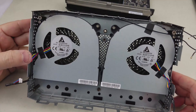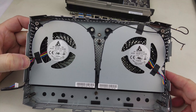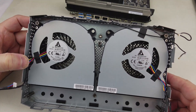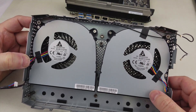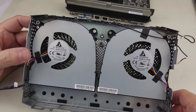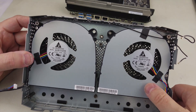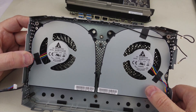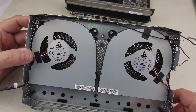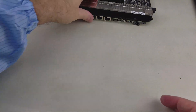There's the blower assembly. I'll get a Skull Canyon blower so you can see how much bigger these blowers are. The Skull Canyon blower is a much smaller blower — maybe this portion of it. With two much larger blowers in the Hades Canyon, we can spin them slower and still get more airflow. We could spin them at half the RPMs to get the same air as one, but since we have two we can spin them at a quarter of the RPMs.